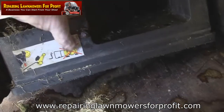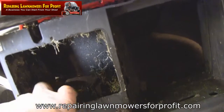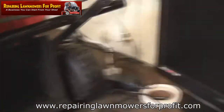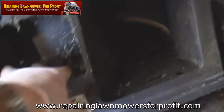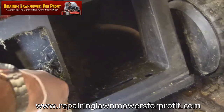We're going to need to get this belt off so we can get this blade adapter off and swap over this part for the blade - as I showed you where the pins are. To do that I'll probably need to take this belt off here as well. While I'm there I'm going to clear that grass out and make sure it's not going to pull the belt off, because I really don't want to have to buy another belt.